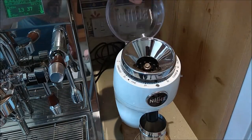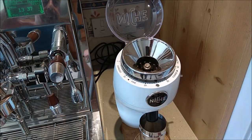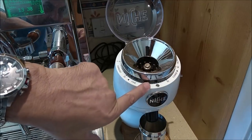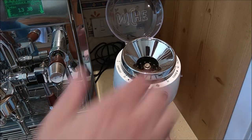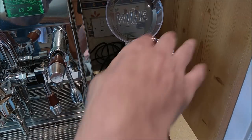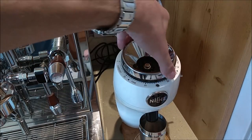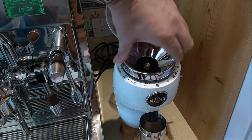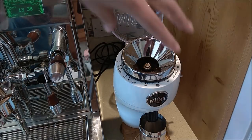Let's say you accidentally twisted this ring and took it out of adjustment. Now there's a white dot here — you probably can't see it easily in the video. I'm going to show you what you have to do to adjust the grinder. You cannot just turn that grinder using the silver ring, not the black. You can't turn it all the way because there'll be residues of coffee which will change finding the adjustment point.